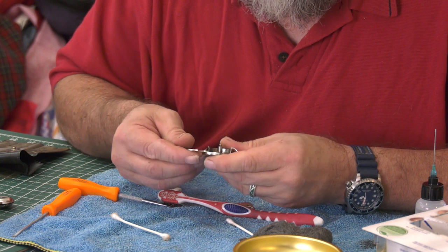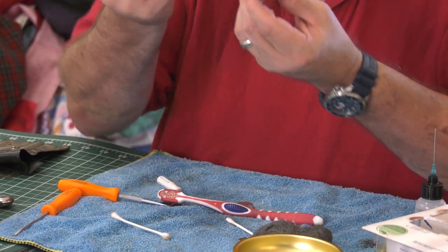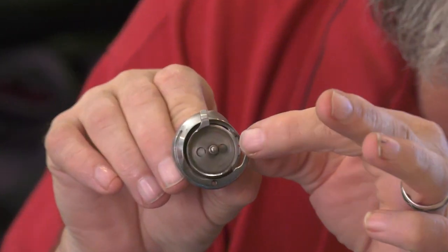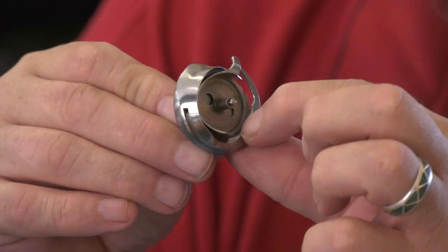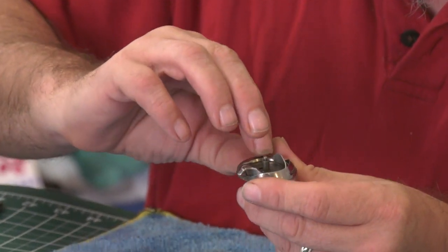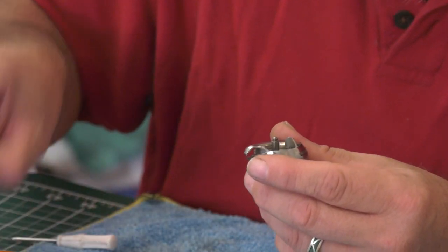There we go. Let's slide the gib hook back into position. And you've probably heard at this point from other people, and I just may repeat it just to hear me speak. When you're pulling a gib hook out, don't pull on the hook up here. Always come down to where you've got a meaty area and pull, because this may bend your hook a little bit. So always do it on a meaty portion. There we go.